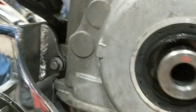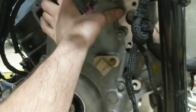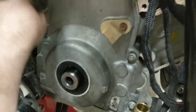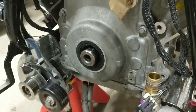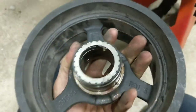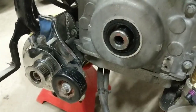Now we've got all the hardware and the timing cover all the way around. Don't forget your alternator bracket that goes on to the timing cover. Nothing is tight yet. Unlike a small-block Chevy, these don't actually have a dowel that retains them, so the plate can actually move around just slightly. Something I like to do to help center it is actually install the balancer before tightening the timing cover all the way to spec. That way it helps center up the seal so you don't end up with leaks coming out of the front of your crank.